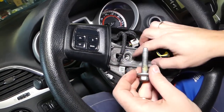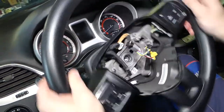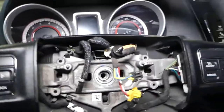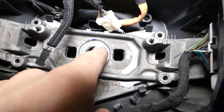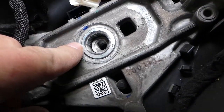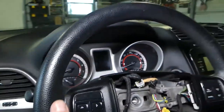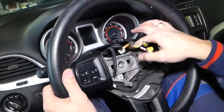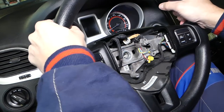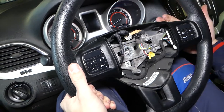It's a very long bolt. Now I'm going to bring the steering wheel to point up. You cannot mess this up — let me get the camera close so I can show you. That dot right here aligns with a dot on the inside. I'll be able to show you that dot once I pull the steering wheel out. We have to be careful and feed the wires through the steering wheel for the airbags.